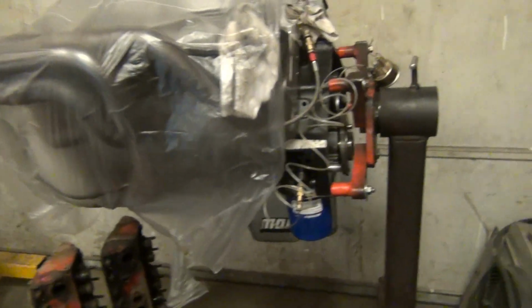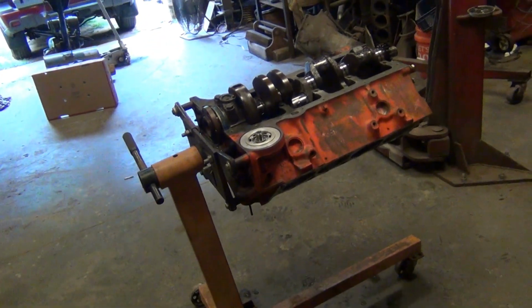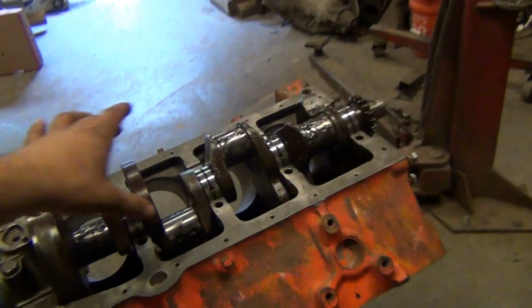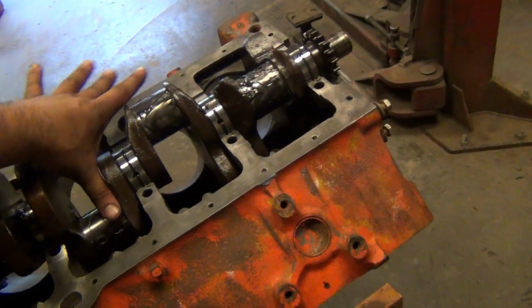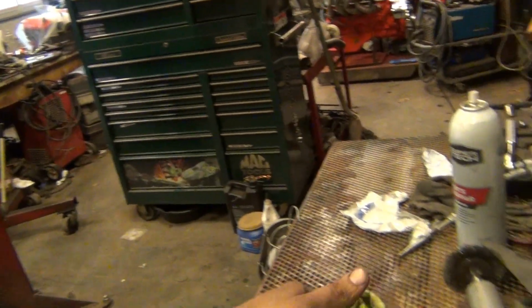But I had to turn the guts out of this thing to get any kind of power out of it. But the combination I'm putting together for him, he's not going to do that. I mean, it'll turn 7,000 RPM. To me, it doesn't seem like a whole lot of RPM. Like Colton's 4.6 right here. This one goes to 74 every time it sits down in it. This can go there. It'll go 7, 73, somewhere in there. And that's where it'll need to shift. But, yeah, it ain't going to have to see no 9,000 or nothing like that. So, it should be good.